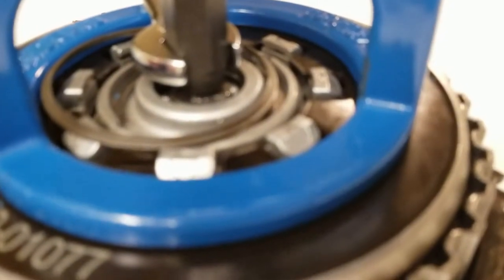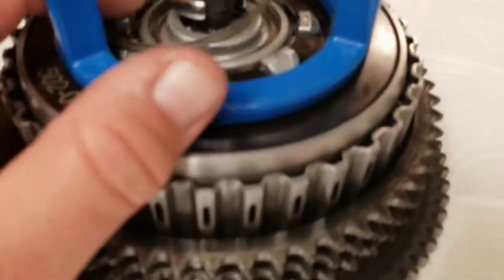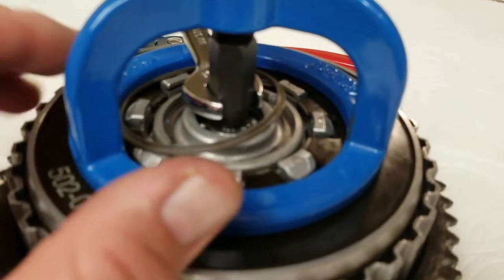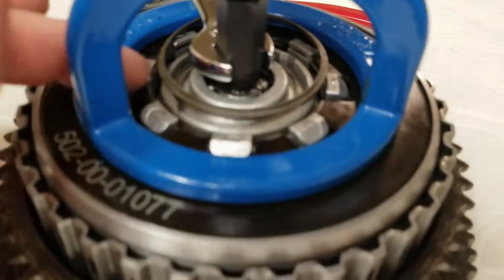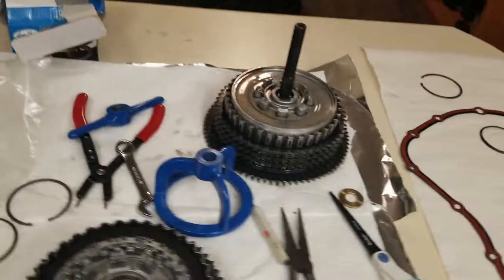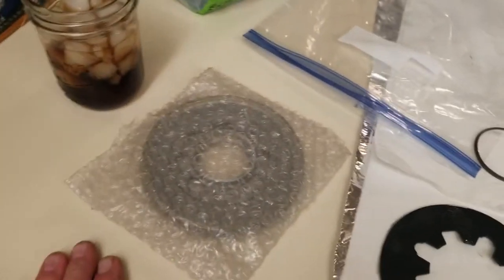You want to get the spring plate just below that groove on those teeth so you're not putting any more pressure than you need to on the pressure plate where that retaining clip is. I have broken this pressure plate before where the retaining clip comes up trying to crank down on here. We actually have a stress fracture in the other pressure plate, but I've got plenty of backups because it's kind of common.